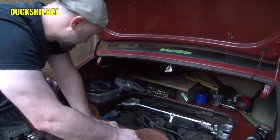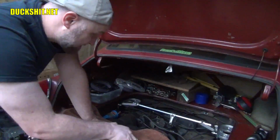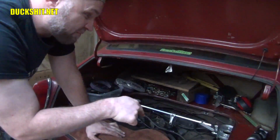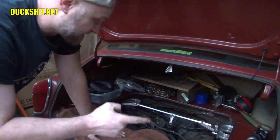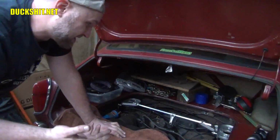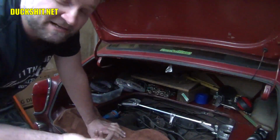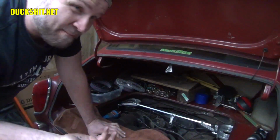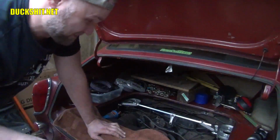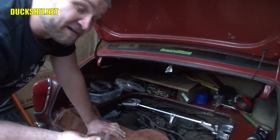Okay, we've got that battery charger hooked up. So I figured now, but one thing that I forgot to check that I didn't before is I probably should go inside and put a brick on the gas pedal and look down inside the throats of these carburetors and make sure that the throttle opens all the way. That's kind of important because I drove this car for almost a year with the old throttle linkage on there, which had all mismatched parts on it, and I always just thought that I had a slow old Volkswagen, didn't realize that it wasn't opening up the throttles to but maybe halfway to 3/4 position. So the thing was just, it was really slow. And after I fixed that, suddenly the thing started to take off and become one of the faster 1600 cars here in town.